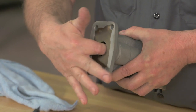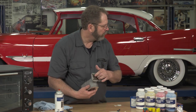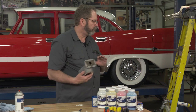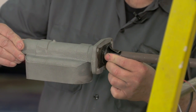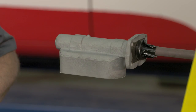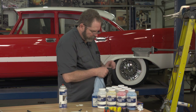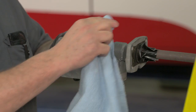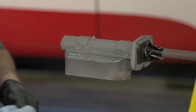The last thing we really need to seal up is the back end of the cylinder bore for our master cylinder. What we're going to do is take a large rubber grommet taped to our grounding rod — when the master cylinder is pressed up against it, it will form a seal without having to tape that hole off, and this gives us a way to suspend it while we're powder coating it. With that, we're going to wipe it down one more time with our Eastwood paint prep. It's a good idea to keep your finger oils away from the part at this point, as that can affect your powder and the quality of your coating.